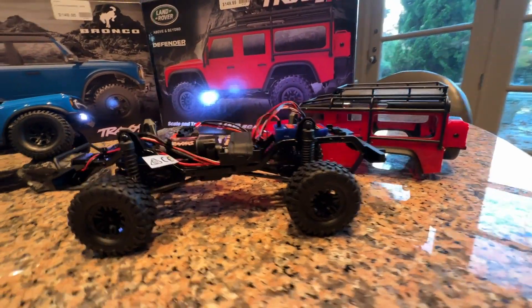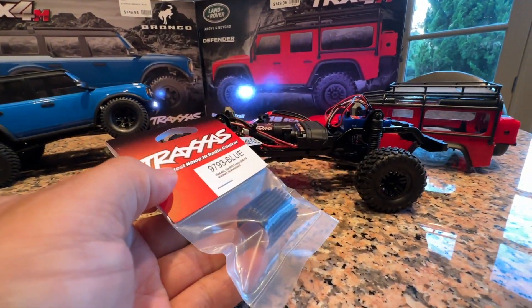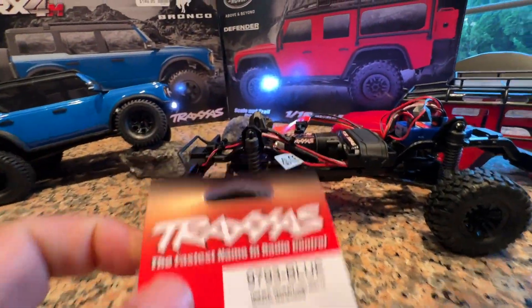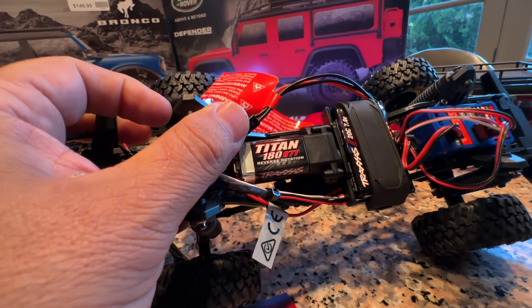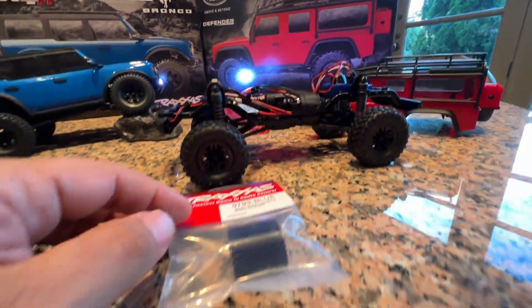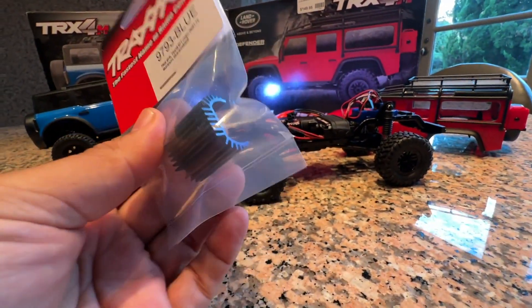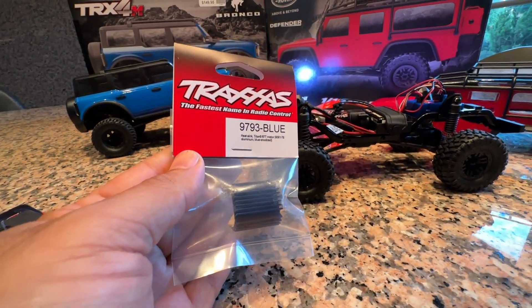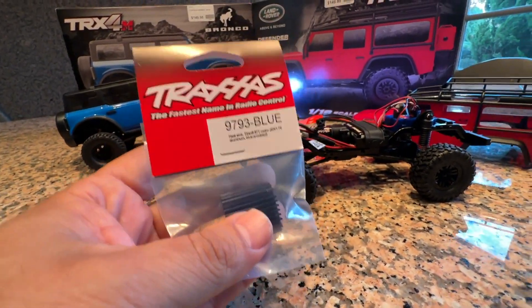One of the cheaper upgrades people overlook is the aluminum heat sink for the motor. It just clips on — no tools needed. It really does make the brushes last longer because it lowers the core temperature of the motor. Since this is a brushed motor setup, the heat sink is definitely going to make a bigger difference. Heat sinks are usually the cheapest upgrade you can do — this is a no-brainer to get immediately with the car.